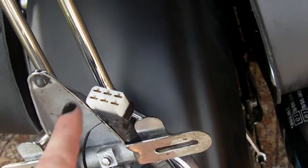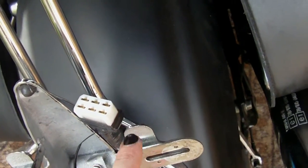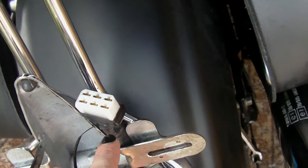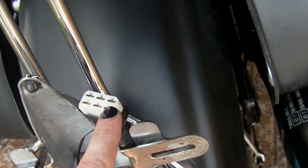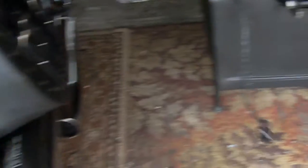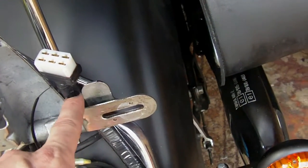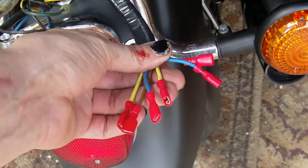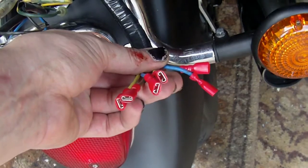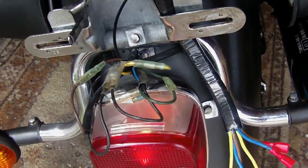This is the block I'm using. It's a six-point block - basically three cables into either side, so three for the brake lights and the main lights, and then three for the indicator units as is on the trailer. I've fed it through here and it's going to be sitting behind the number plate. I've already put some female connectors on there and I'm sorting out the lights themselves.